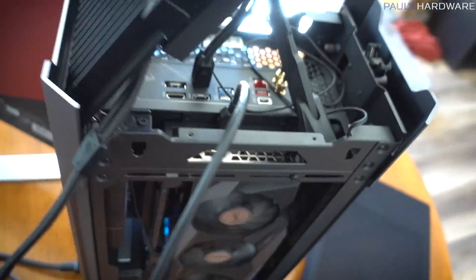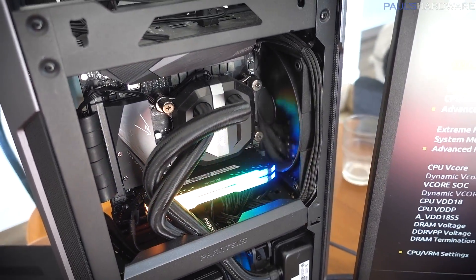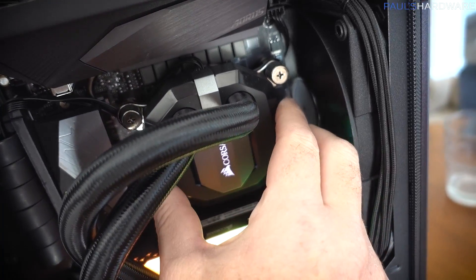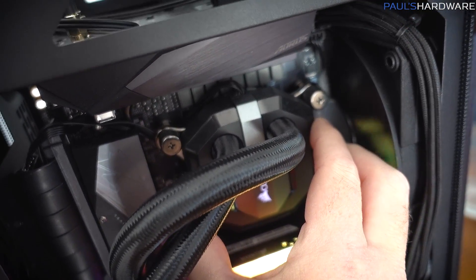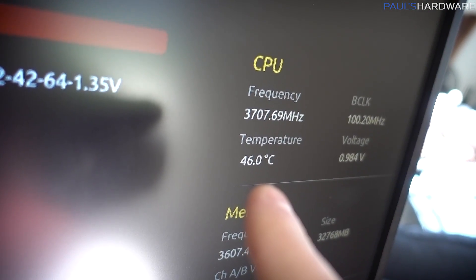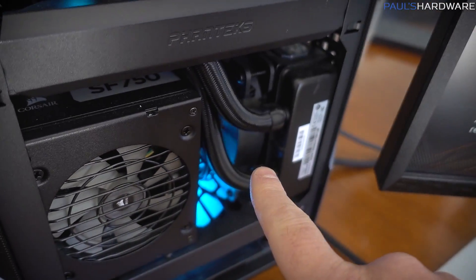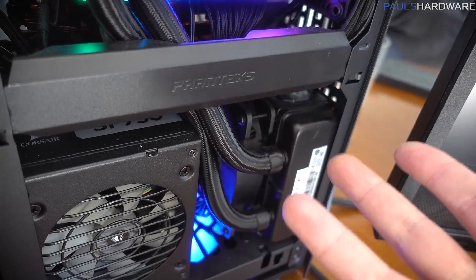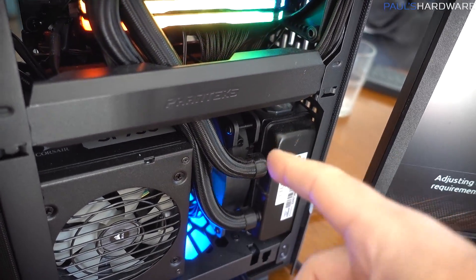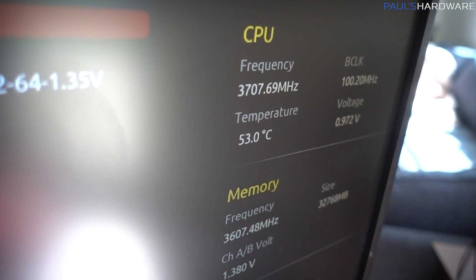Doing that test boot. So if you have an AIO pump that has failed, you may experience something like this. First, I do the feel test — if you can feel the pump and don't feel any vibration at all, there's a decent chance the pump's not working. Second, I'm keeping an eye on the temperature, which started at about 40 degrees and has gone up about one degree every few seconds. The fan down here is going to spin up more and more because the CPU is hot, but since there's nothing cycling through the tubes, there's no heat down there for the fan to dissipate. All the heat is just pooling right up there, and yes — it's still getting hotter and hotter.